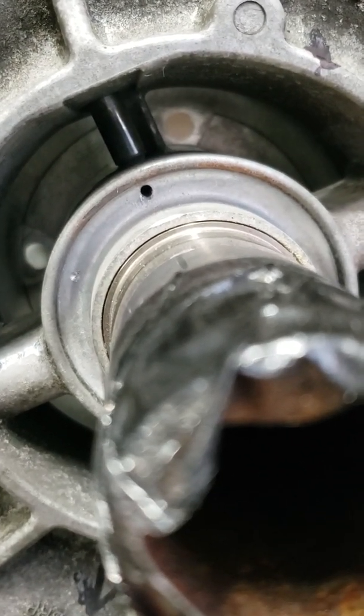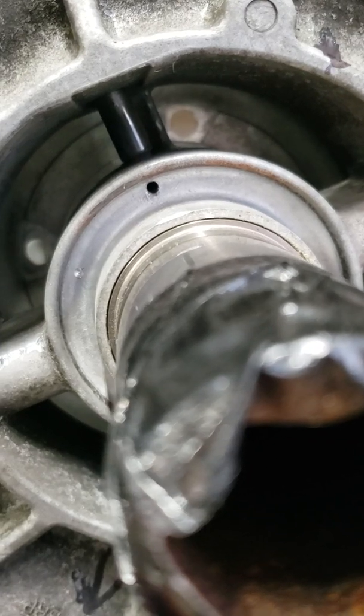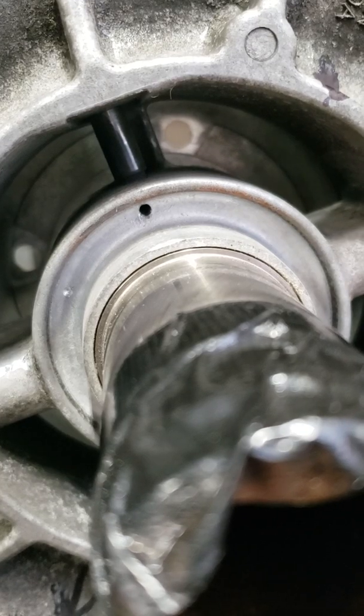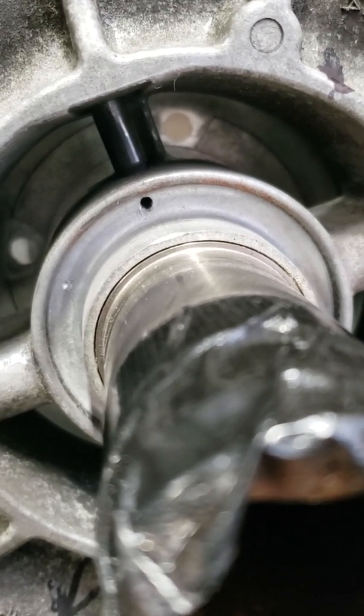But before you do that, keep in mind what you do not want to do. I think in the other video online, the person tried turning the bolt before they realized there were pins on there. That's the bolt that holds one of the rollers right there. Basically you're going to use a T-wrench, a socket, a T27 Torx type screw.